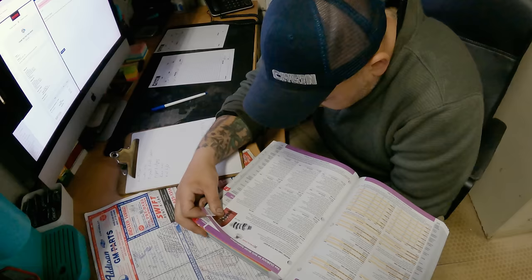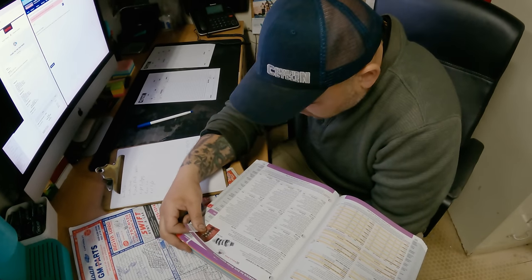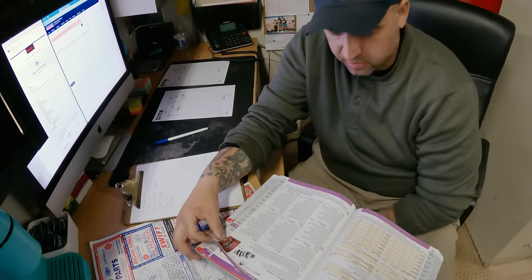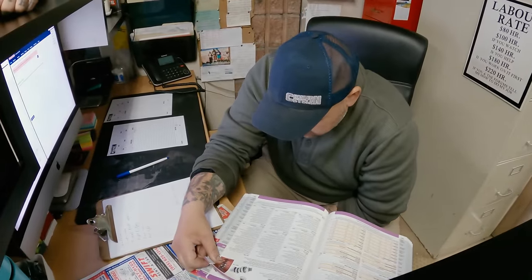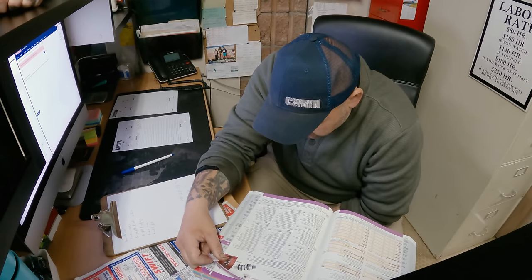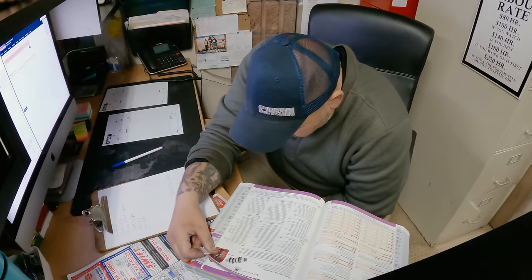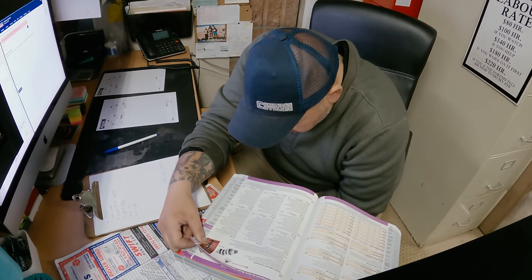Those heads have it already. Yeah, SE cylinder heads have high lift valve springs, but will need to be verified, which is the ones you're getting. Heavy duty one piece push rods are also recommended. Now the 592: getting serious with bore size, ported cylinder heads and throttle body, aggressive camshaft requiring high lift valve springs, performance push rods and lifters. High floats, whatever. Feuling also recommends matching their oiling system. High lift valve springs and heavy duty push rods are highly recommended.